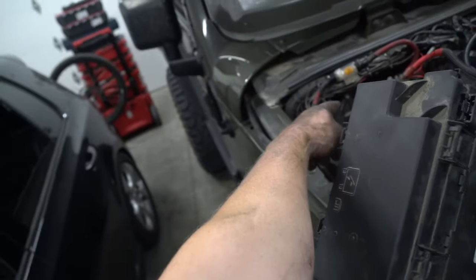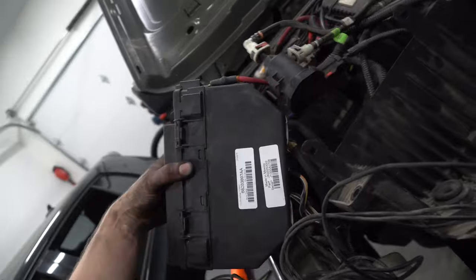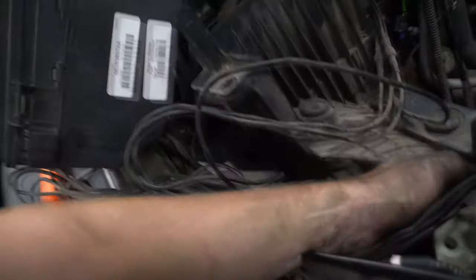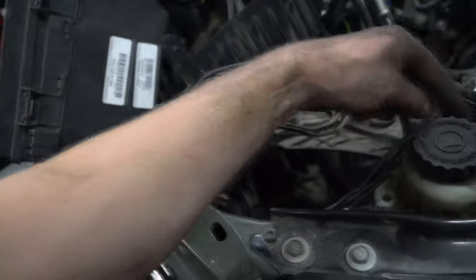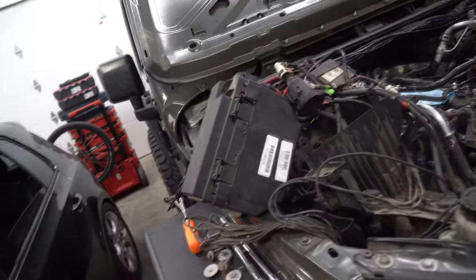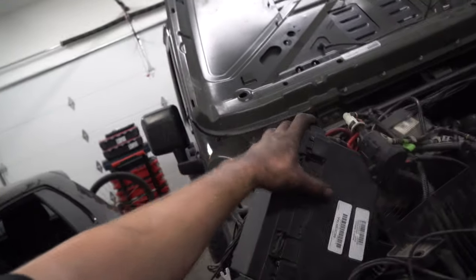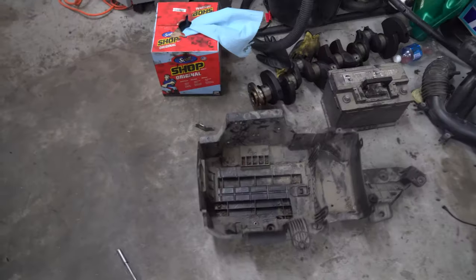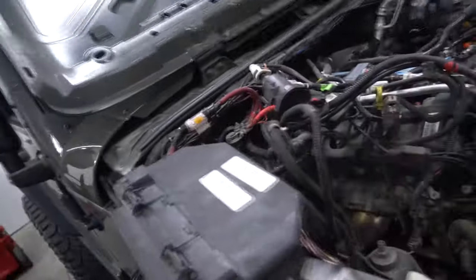Move those so they're not locked in. Once you do that, you can see this is just sitting here right on the side. If this is gonna bug you, put a cloth or something underneath it. Do the same with your fenders if you're worried about scratching. Squeeze this back down, put the knob in, and pop the case out. As long as you've released every one of those barbs this will be fine — if not, it'll let you know. I'm not going to disconnect my fuse box; if you want to, take a picture first. That's an extra 20 minutes but well worth it. Look how much access we've gained now.